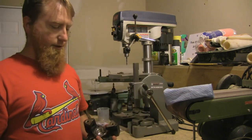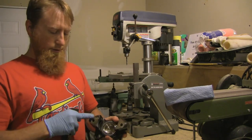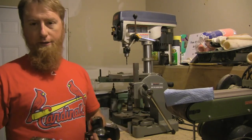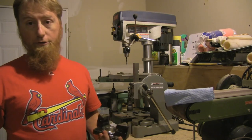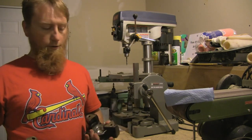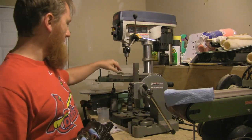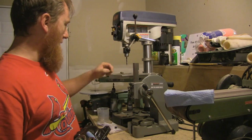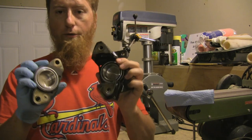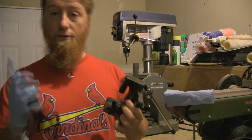That's all there is to it. The guys on the forum were saying that they reused the caliper half seals. I've got some brand new ones — I'll probably stick them in this one. I reused the seal on the other caliper that I already rebuilt and installed on the car, so hopefully that one works. I also bought new bleeder valves — the old ones ought to be alright, but anyway. Quick and dirty rebuilt caliper — once I get this thing bolted back up and installed on the car it should give me plenty of years of service. Thanks for watching.